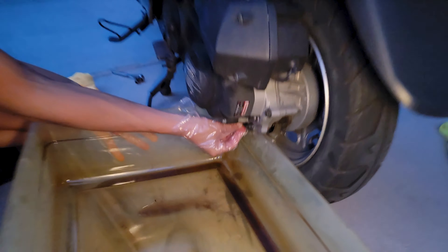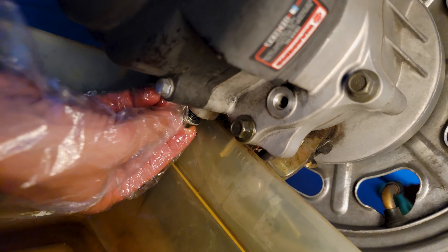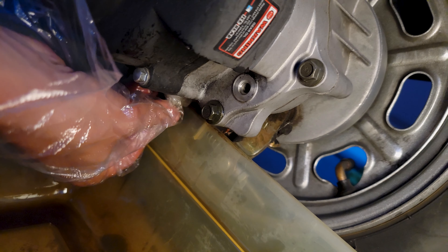You're going to see a little bit of it go through and it comes out through the fill plug running nice and clear. So all the residual of the old stuff is out. Now we go ahead and cap off the drain plug. These are all aluminum and very soft — 10mm bolt sizes — so you don't have to go tight at all.